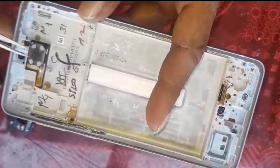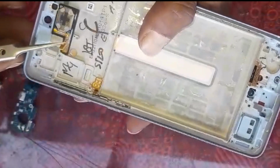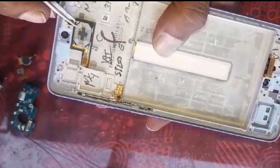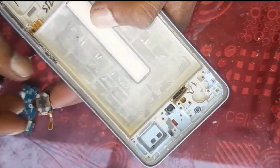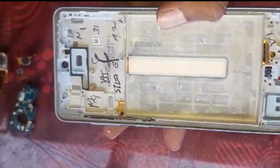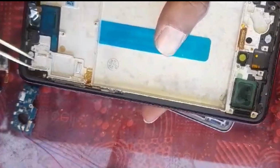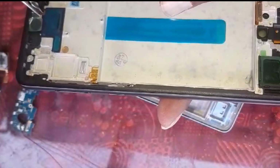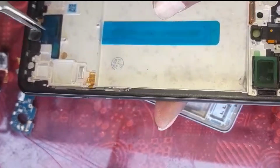The ringer, it's magnetic obviously. Then we're going to go to the main speaker, the earphone speaker, and we will see if the buttons are coming or not. Gently remove this also. Use plastic tools so you don't damage anything. Now our work here is done except this, so let's see. Yeah, the new LCD has the buttons. This is supposed to be sticking inside, so we're going to fit it now with all the things with the new LCD.